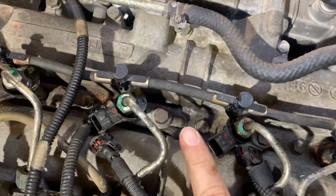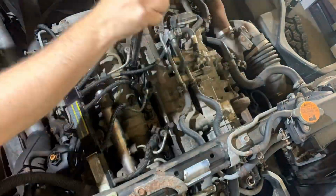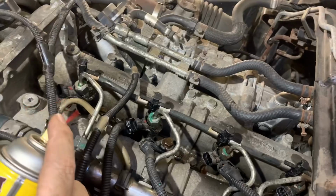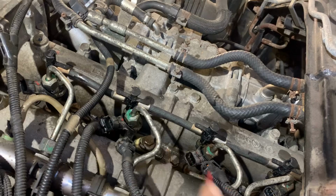Before I completely remove the injector lines, I do want to remove the bolts that hold the injectors in place. Start by just cracking each bolt free. You're probably going to want to use a half drive at a minimum. Those suckers are tight. Again, I highly recommend you get some PB Blaster in there, not sponsored. Once you get the bolts cracked free, let this get in underneath and soak down. It will make your life easier. Don't be afraid to use this stuff. It's worth it. Even more so than I'd realized at this point.